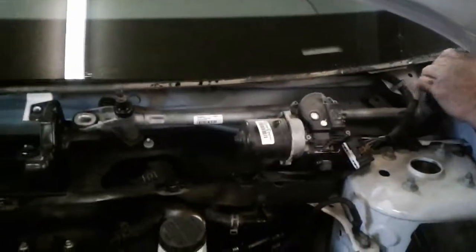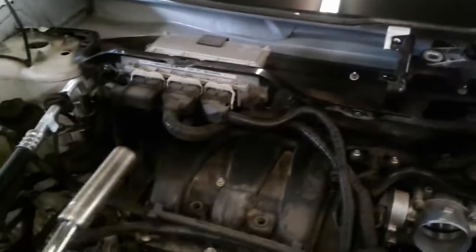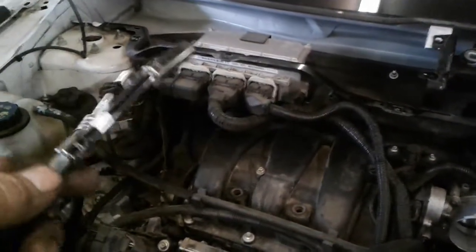Update time: take the front cowling off all the way across — both top and inner pieces — then the windshield wiper arms, then the windshield wiper assembly, and then pull that plastic piece off. We'll probably have to move the computer out to get to a bolt behind it. I've got to look and see, but it ain't too bad yet.